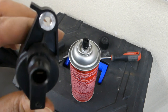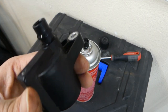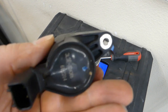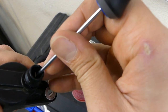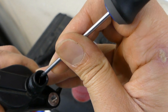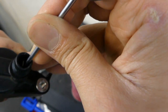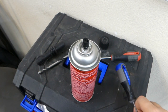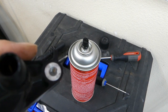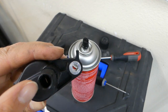It's going to take maybe a minute or two, maybe three per coil-on plug. But just remember, an entire new one of these — including the boots, the spring, and the main part of the coil-on plug — is at least $45 to $50 from Ford. I just work it all around, get it right across this flat part, the end of it, all on the main top and bottom. I just take my time and you'll see it come off. When it's done, it should have this nice copper color. And that's how you know you've got it clean. Then do a final spray out and let it dry.